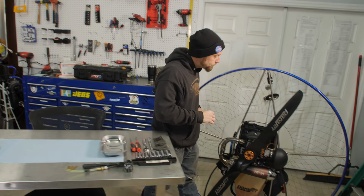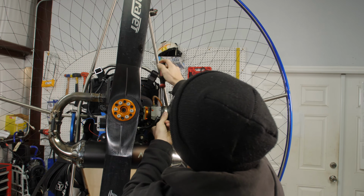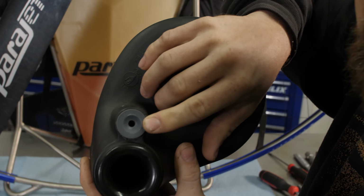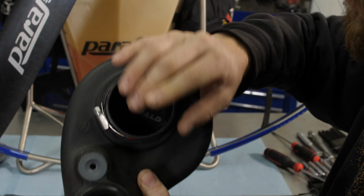First thing we're going to do, airbox needs to come off. Let's take the hose clamp off. We're releasing it from the collar. Ensure that the snap lock, it's a 16mm Vittorazi snap lock, is in good condition. This one is. This has been replaced recently.